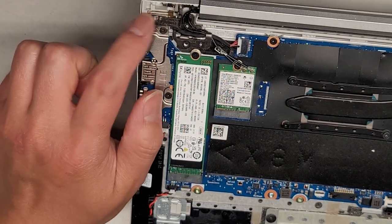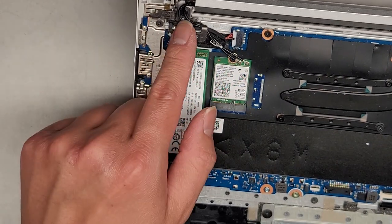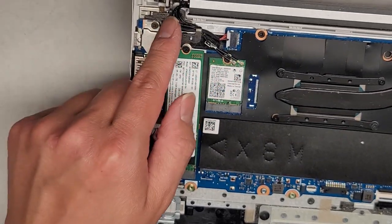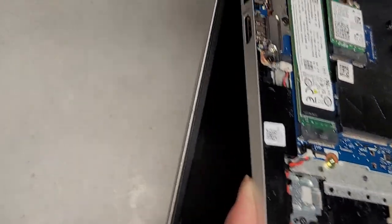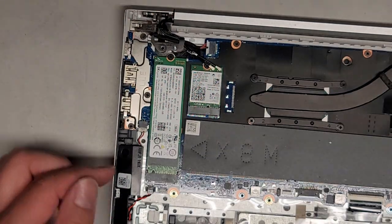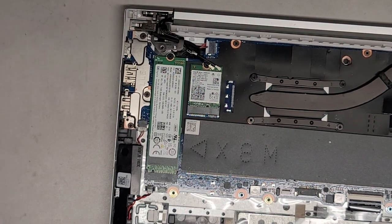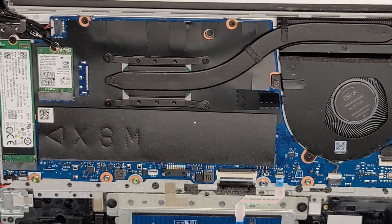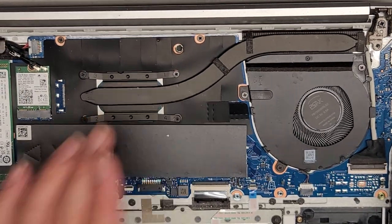You've got the DC jack charge port here. To replace it, there's a screw under the antennas you need to remove, then you can pull up the hinge. If you're not strong enough, after undoing the screw, lift and open the laptop slightly. Take the screw out, then slowly lower it down and the hinge will stay up — then you can easily pop it out. The CPU is soldered to the motherboard so you can't upgrade it — most people wouldn't have the tools for that kind of rework.